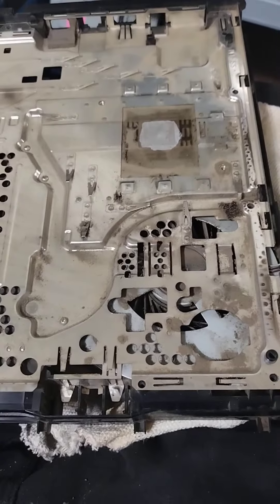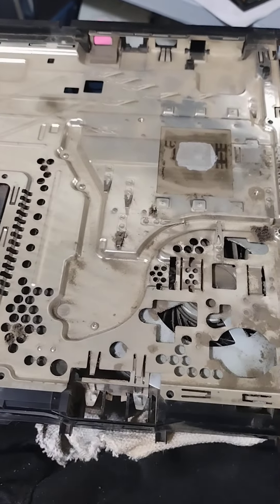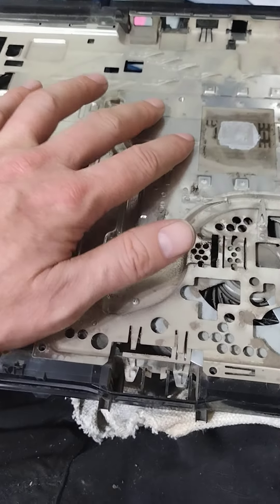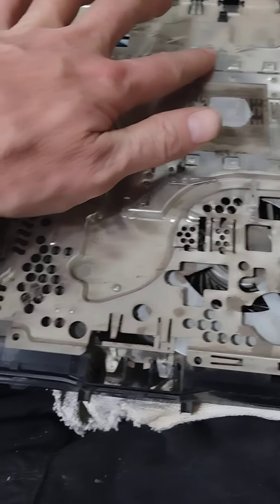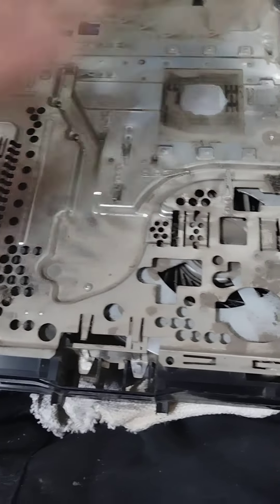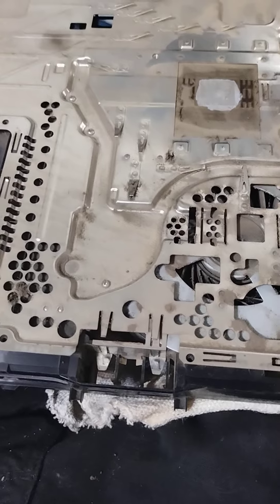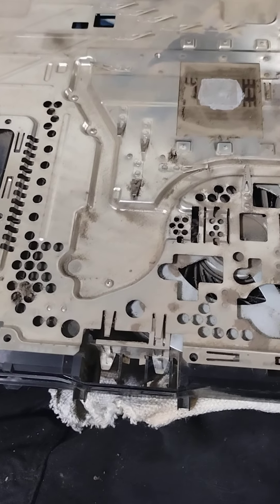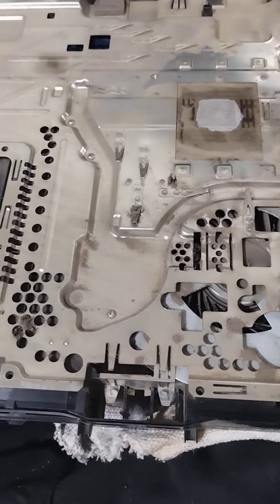So now we are inside. I was about to do the repair, but I was just explaining and showing how dirty it was and how it's going to need the thermal compound replaced. I'm going to replace the thermal pads — we're going to give it a whole little makeover basically. And most shops don't do anything like this. They'll just literally fix the issue, leave it all filthy, slap it all back together and send it on its way.